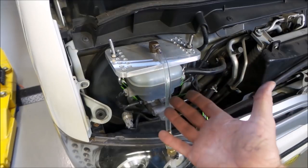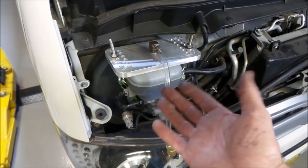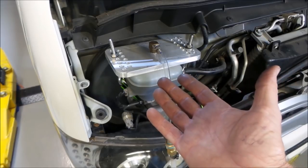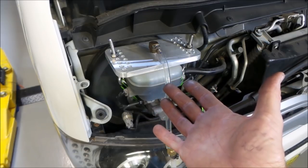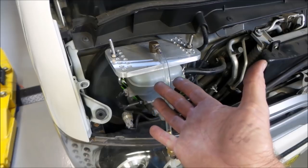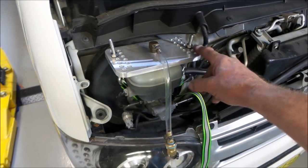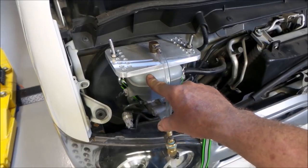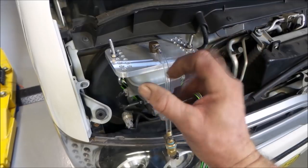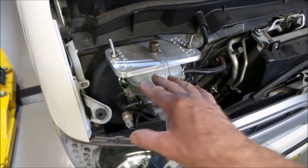The pump, any cheap garden spray will do the job. I advise you to get a gauge just so that you know where you're at with your pressure. All you need is 10 to 15 PSI, that's plenty to perform this task. And as you see, 15 PSI on the gauge on the pressure sprayer is really easy to achieve. There's not a whole heap of force down on these nuts. There's not a whole heap of force on this. That silicon toilet washer is doing a really good job. That was like $2 at the hardware store.